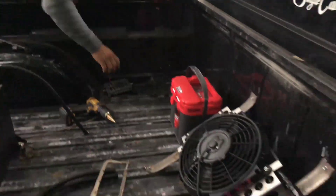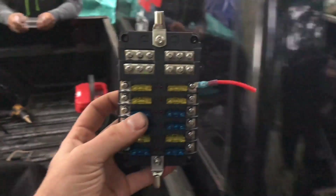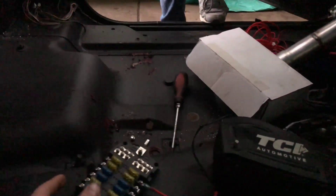You've got your fuse block — let's show them the fuse block real quick. It's the same one I have. So what we're going to do is put his fuse block right here, which is the center of his cab, kind of towards the floor. We'll ground that right to the back, and then another power source right to the block. That way his power source is going to be coming from here — we can run whatever grounds and positives we want to that, like his fans and radio, whatever.